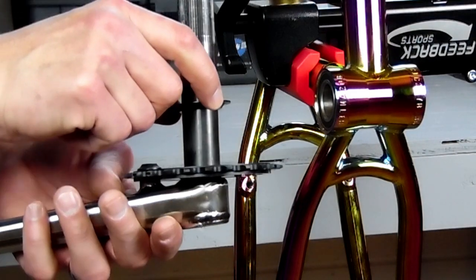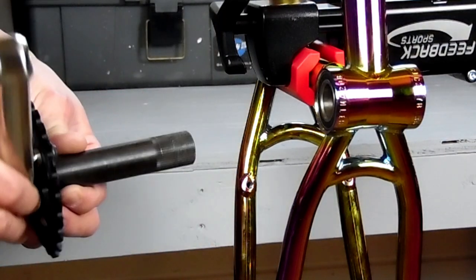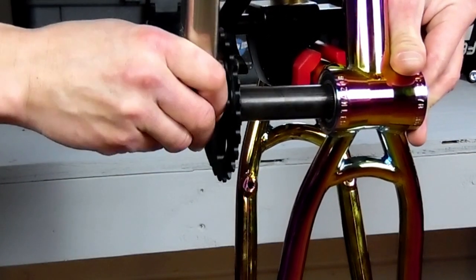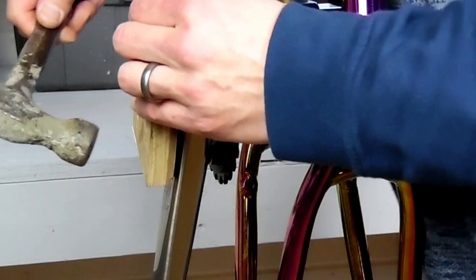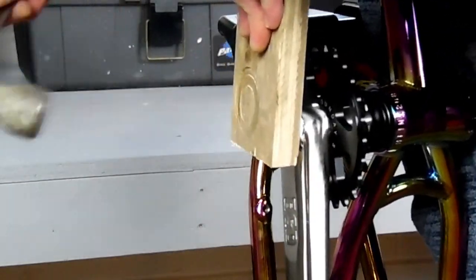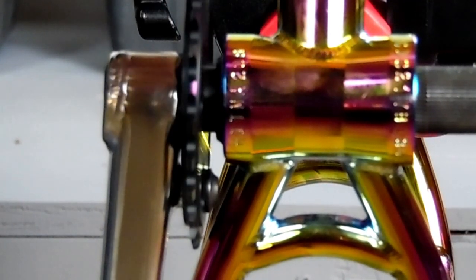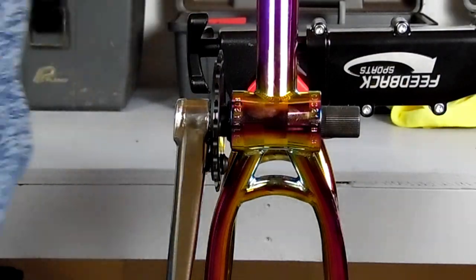I'm going to show you a two-piece install I did on a Mafia frame. A Mafia frame, I think, just has a really thin bottom bracket housing, and that's why I needed so many spacers. On this install you can see that I had to stop well short so that the sprocket didn't hit the frame. From there I just held spacers in the gap to see how many it would take to fill that gap. And then once you have that figured out, you remove the crank again.